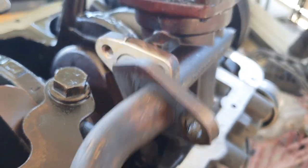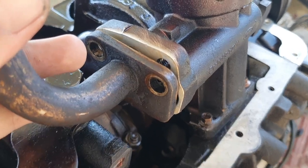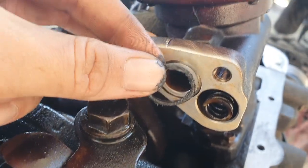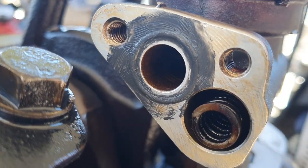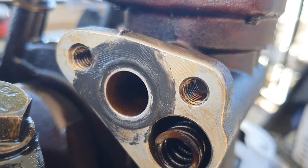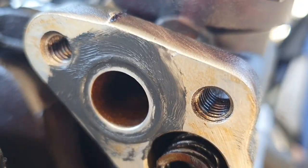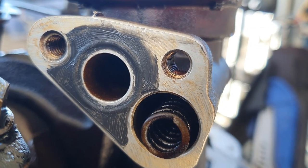The oil pickup is in here but it has an O-ring — you can't really get new O-rings locally, maybe order online. I still have the old one; it's not ideal to reuse, and you shouldn't put sealant on it because the sealant can break off and go through the engine past the pickup filter. I'm using Ultra Black which has the highest oil resistance, just a very thin layer to rejuvenate that O-ring, wiped away from the inner so it doesn't go into the oil pickup.